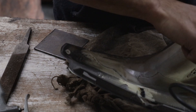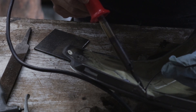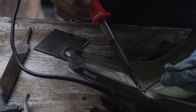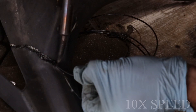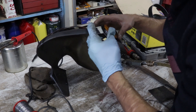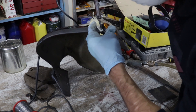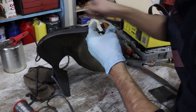Now you're ready to fire up your old soldering iron and start welding. Start with an easy crack to gain some confidence, then get good at melting the base material a little bit before you add your filler plastic, and just keep dabbing along like that. Too much heat and you'll burn through; too little and your parts won't be as strong and won't stick together. On trickier cracks where you need three hands, start by either clamping the parts in place or melt the start and end of the crack together to act as tack welds — these will hold the part as you weld. Spiraling the plastic from the surrounding regions in a little bit just to hold, then cooling it down rapidly.